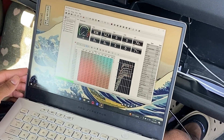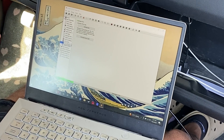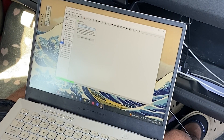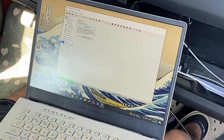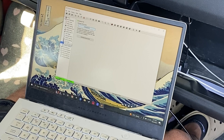With the map downloaded from the ECU on K-Tuner, go into Main Parameters and scroll down to find TPS Calibration. I don't really like this too much, but all you're going to do is click Zero. There's no confirmation that it was calibrated — just make sure that it was highlighted blue and click that, and then that is it.